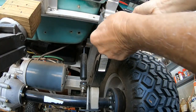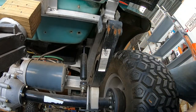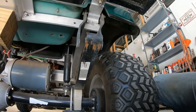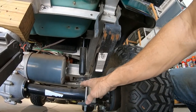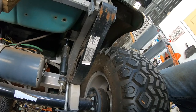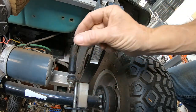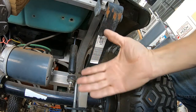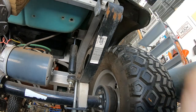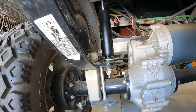The old shocks have a single nut on them, which is how most automobile shocks mount — the nut squeezes the rubber down and keeps enough pressure so it won't back off. The new shocks I'm putting on have a nut and then a locking nut — a thin nut, not as thick as a normal nut — because it's just locking; it doesn't actually have to hold anything. I don't really feel it's necessary for shocks, but since they sent them I'm putting them on. You can see over on the other side the two nuts on the bottom, same way on the top of the shock.